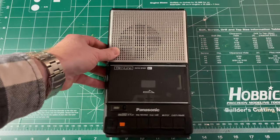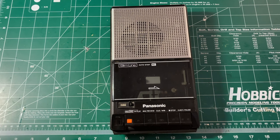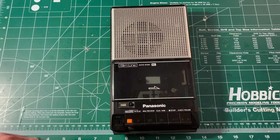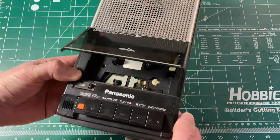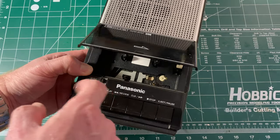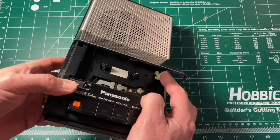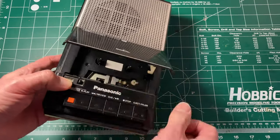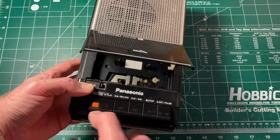When I look at something like this, first I check: is it really bashed up? Not just rattling-around-in-a-box bashed up, but plastic broken. Because if the plastic's broken on it, the chances with a mechanical thing like this is that it's not in very happy shape. The next thing I look at is the mechanism — is there any corrosion? As you can see there's some dust and the nylon gear here has yellowed a bit. But none of the steel in here has yellowed. The paper hasn't come up from the little window. I can see a belt here, so there is a belt on it.